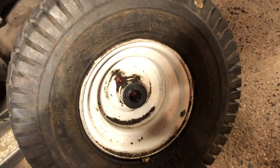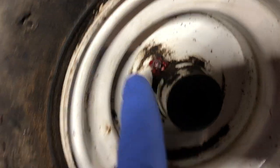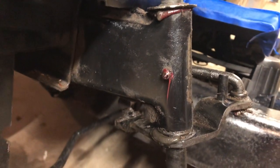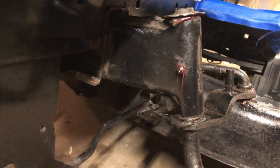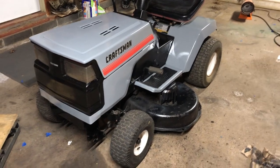The wheel and tire are looking really good, nice and seated. One quick tip: anything with ball bearings or a grease point — make sure you're greasing it. I have a grease point right there on the hub, so I put my grease gun on it and squirted until grease came through the center of the hub. There was also a grease point on the steering knuckle — I put grease in there until it started pushing out the top. Make sure these things are properly greased.